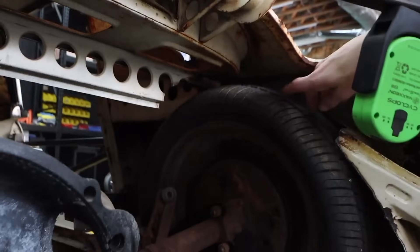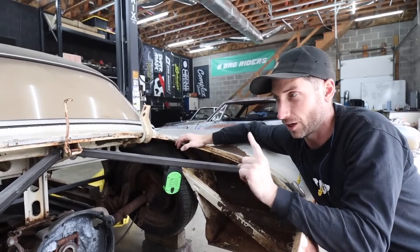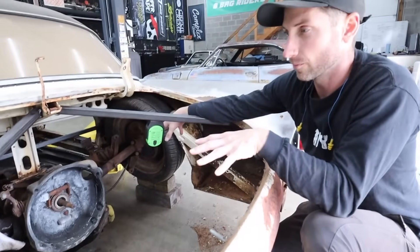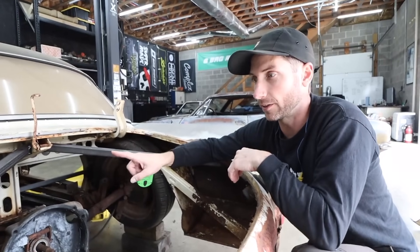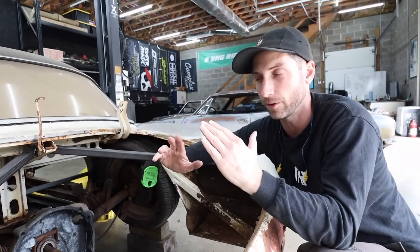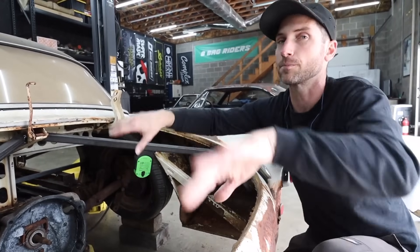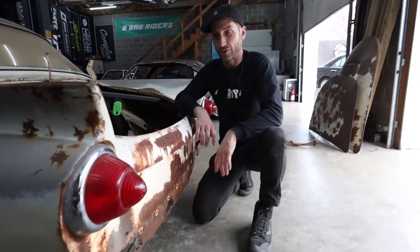You can see how far in the rear tires are now — almost to the parcel shelf, which isn't too far from the window. What I haven't checked yet, which I want to on camera: the ground simulation is about eight inches — we've got it on two four-by-fours. Since the pan is laid out, I really wanted to simulate the ground and see if the body's touching. Ideally I'd like the body to touch the ground with the pan not quite completely aired out, because this is a swing arm with a ton of camber. I'd like to be able to drive it without a bunch of camber — so if we can put the body down over the pan a little more, the body will lay up before the suspension is completely exhausted to its crazy negative camber.